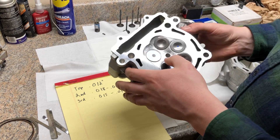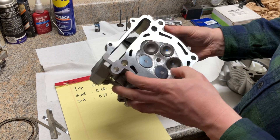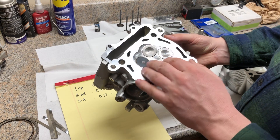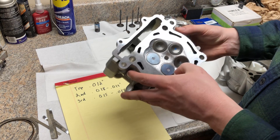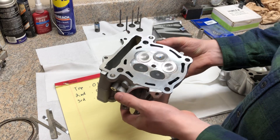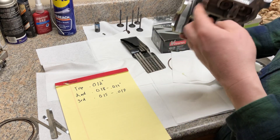The one thing I noticed when I first looked at this cylinder head is the texture of the port work. He massaged over the chamber very lightly — didn't do a whole lot to the chamber and I don't think the volume went down very much. The tool marks are very evident — it's a little rough surface, not bad, but you can see some tool chatter marks.